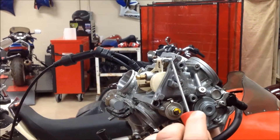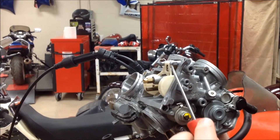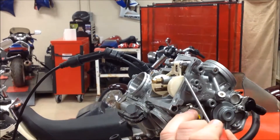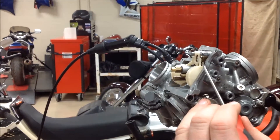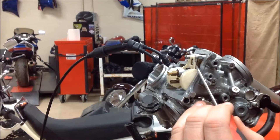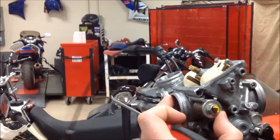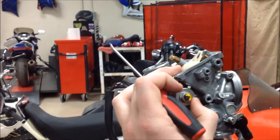The angle of the ears for the float pin itself and the float typically make a 90-degree bend — do you see that? What I'm doing is making sure that the float is just touching the pin, just touching it. See how it bounces a little bit? If I were to tip this, that'll allow the pin to kind of float or suck down.